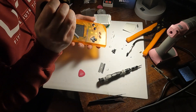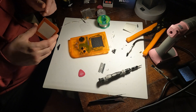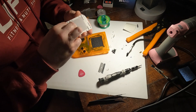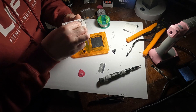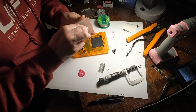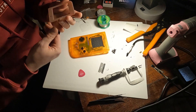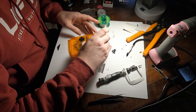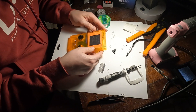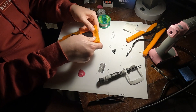You want to make sure you're working in a clean environment. If there are any little specks of dust or anything in there, just hit them with the air tool and make sure it's nice and clean. You can get these air tools in a camera lens cleaning kit — they're not very expensive at all. Once that's all settled and it's got no contaminants on it, you can take the backing off of the lens. This one had a little piece of paper backing that stayed stuck in the middle, so I ended up pulling that off later. But around the edges you're going to have your adhesive that's going to hold on to the casing. Just gently put the lens into position, make sure it's lined up correctly, and apply pressure all the way around to make sure the adhesive really gets in.